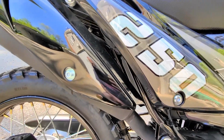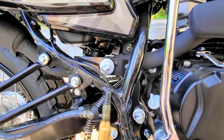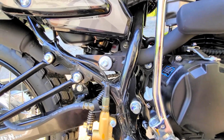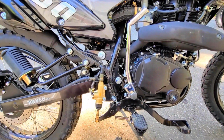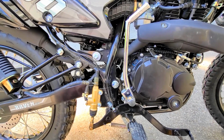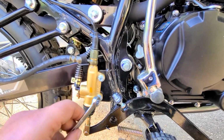When you get your bike, check every bolt you can get to, and then some. Don't over tighten and break them either. Some people use Loctite. I prefer RTV silicone gasket maker. That's what I found to be the best for vibration, especially if you want to take the screw off in the future to work on a bike. Loctite makes it a little more difficult. The siliconized RTV comes right off easy, and it won't let the bolt vibrate off because it's like a rubber. I have many people ask me about that.